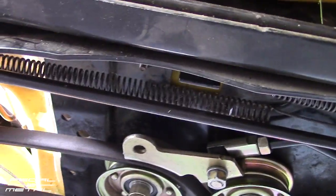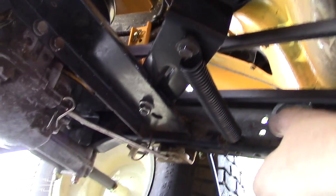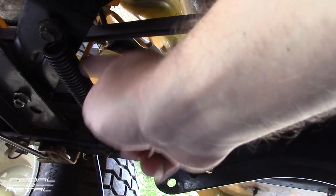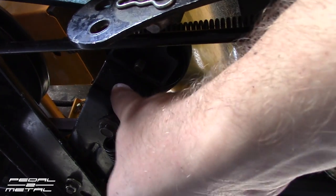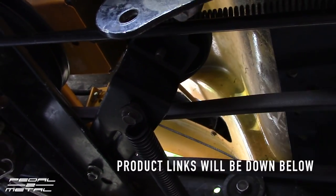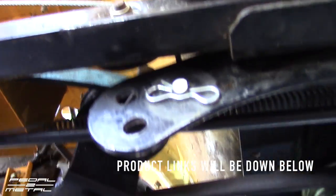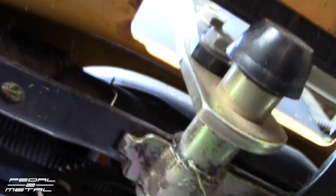The other key to getting this running right — dust falls on my face — I replaced this spring here. I know a lot of these are expensive, like nine dollars or more a piece, but this pulls the bracket in. This is very important for the varispeed pulley. There's an idler on there which you can kind of see up top. It's very important to replace that spring because it pulls this tight — it draws the smaller secondary drive belt nice and tight. I also went ahead and ordered this spring here which connects to the gas pedal.